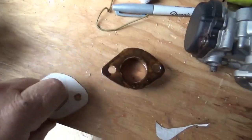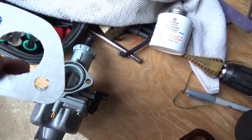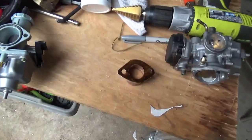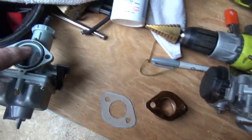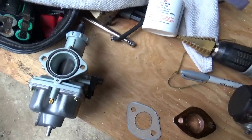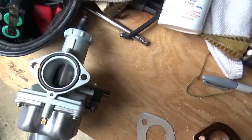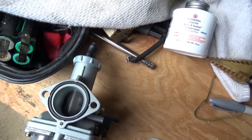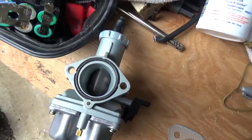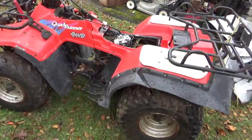I finished making the flange converter and I made a paper gasket. I'm going to put this paper gasket on, and then when I bolt this on, the o-ring does a halfway decent job, especially when you smash it into a paper gasket — that's what I like to do. Theoretically the o-ring alone is enough, but I'm trying to make this reliable and put it together only once. At minimum you should oil the o-ring — just put a little motor oil on it, that'll help seal it better.